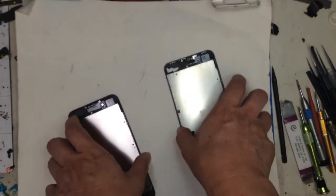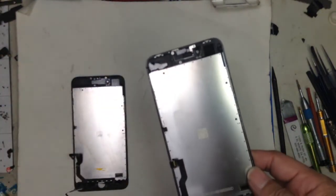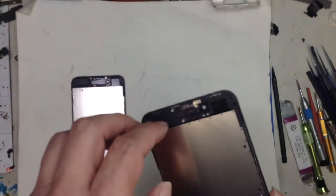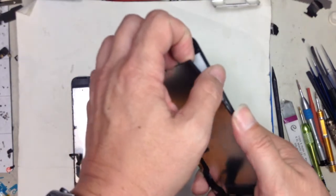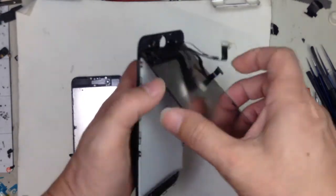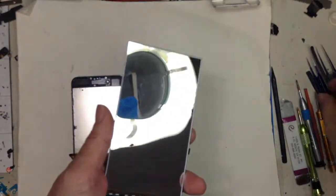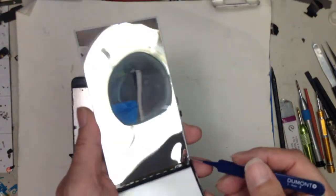And about the 3D touch, Apple has discontinued it since the iPhone 10 and up. No, actually the 10s has 3D touch, but the iPhone 11 and 11 Pro series do not have 3D touch anymore. But until then, Apple implemented a function called 3D touch, and the 3D touch panels are actually, let me just tear this apart. The 3D touch panel is right here. This is the reflector for the backlight.